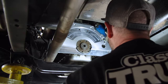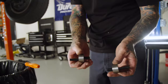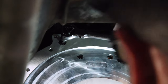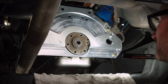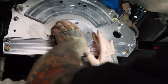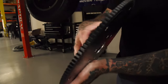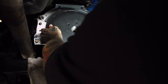That's what I wanted to hear - that solid thunk. With the adapter plate on there, Wheelcap supplies these offset fasteners and we'll go ahead and screw those in now and put the rest of the hardware in. Now we're going to put the hub spacer on - it's only going to line up one way onto the crank. Now we'll put the flex plate on - you've got to make sure you put it on the right way. This is going to be the engine side, yellow line to yellow line, like so.